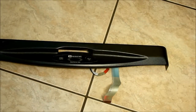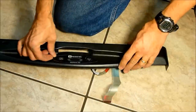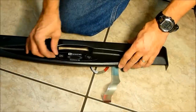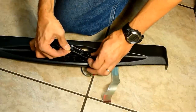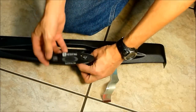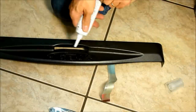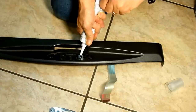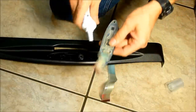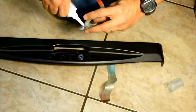The first thing I'm going to do is remove the new touchpad assembly — get under it with a fingernail or a small screwdriver. It's held on with adhesive, so be careful not to flex it too much and it'll pop right off. Pull the cable out through the hole. Then I've got a little bit of silicone RTV — I'm going to apply silicone right around where the cable goes through, as well as on the back, because right in here is where the corrosion occurred as moisture got in.